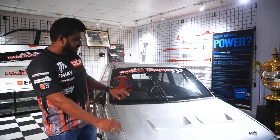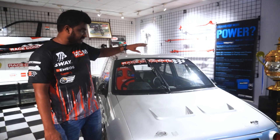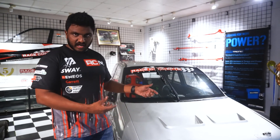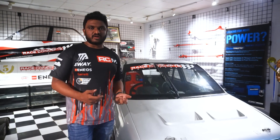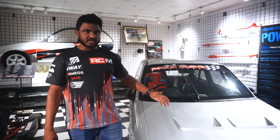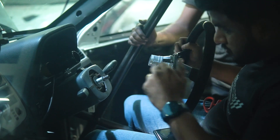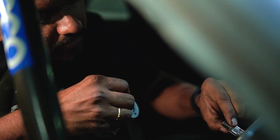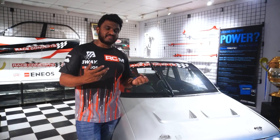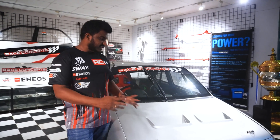That's when I started literally tearing down this car to its bone. We went about doing a complete roll cage — and it was not just a roll cage, it was the entire chassis that was redesigned and literally redeveloped in some places. Most of the key points of the arms and the suspension, the main bits that would give the car cornering abilities, all of them have been tweaked and completely re-engineered. Nothing Zen underneath — it's everything that I wanted under the car. I wanted the car to turn very, very tight. Generally the Zen has a very, very lazy steering rack ratio — quite lazy. The minute you turn the wheel, the first five degrees, you don't see anything, and then is when the car actually starts to change direction. To make the car direction-change extremely pointy and quick, had to do a lot of work on the car with the entire geometry.